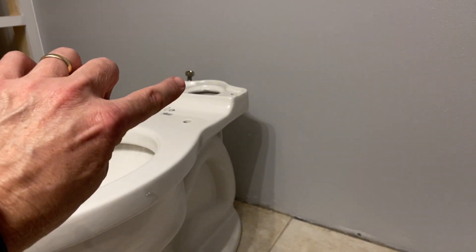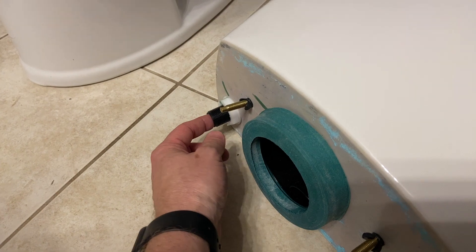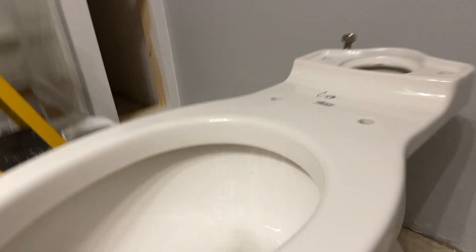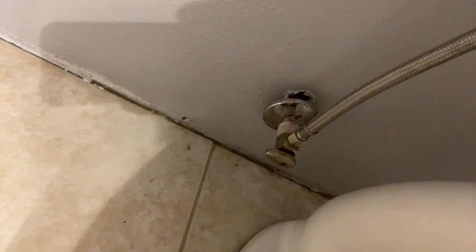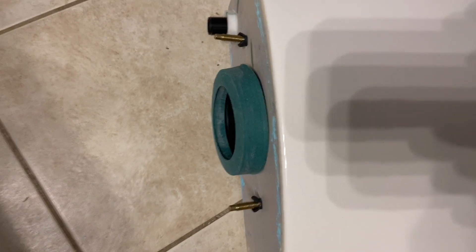The final part — that's the water line coming in, and that will hook up right over here. Now, this is plastic and that is metal, but because that is a compression fitting, it has a little gasket inside it. We don't need to use Teflon tape or anything. That black gasket will draw up and seal. We don't need any Teflon tape on either end of this braided line because those were also gasketed compression fittings. Make sure everything is seated properly, lined up, and we're good to go.